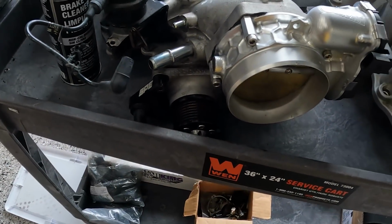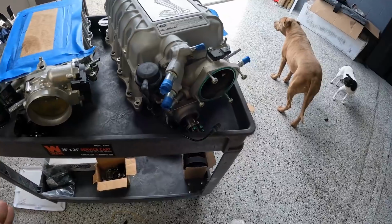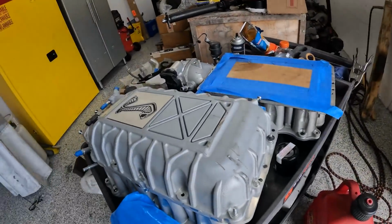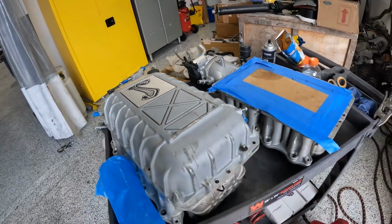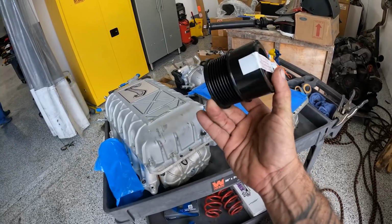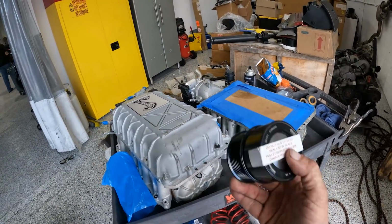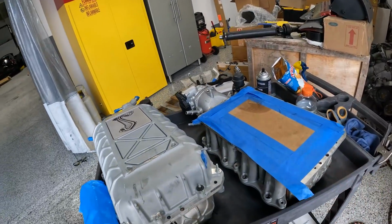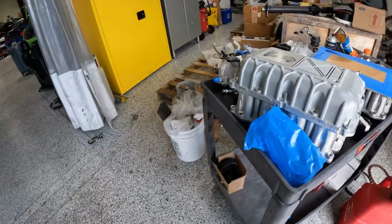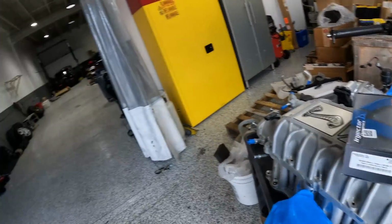And this is good for most of the cars that you've seen on our channel so far. Guys that want to switch it up, sometimes run E85, sometimes run 93. But there's probably even more of you guys out there that just want to do something fun and don't want to mess with the E85 and fuel systems and things like that. So this is a 2.7 pulley. We're going to do that with our ported blower. And one other part here, ID1050Xs. And of course, our tune.